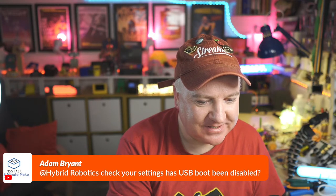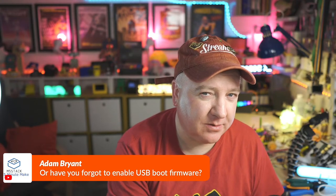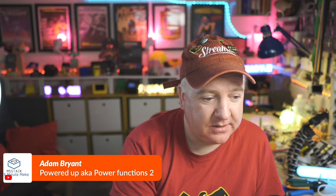Really appreciate it. So Adam says, check your settings. Has USB boot been disabled? Or if you forgot to enable the USB boot firmware. Yeah, there is a firmware thing you need to apply, I guess. Sometimes settings can get overwritten by newer versions of Raspberry Pi OS when it updates. Possibly something like that. Could be an issue with the drive itself. It's not unknown that they fail. I'd connect that up to another computer if you've got one. And if it's not the same Raspberry Pi 400, have you got a different Pi 400 or a Zero or a Pi 4 you can connect to, or an old laptop, just to see.